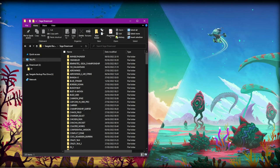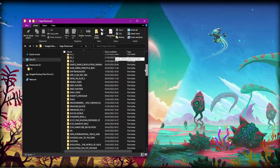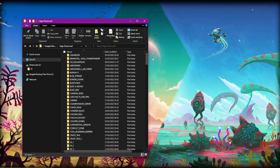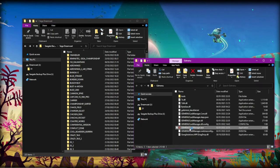This is the folder I've been using to store all my Dreamcast GDIs as I backed them up — it's become a mammoth task. There's over 250 gigs worth of disc images. We want to get as many as possible onto a 128-gig SD card and the rest onto whatever I can find. To prepare the SD card, if you're using anything over 32 gigabytes the card needs to be formatted in FAT32. Newer versions of Windows only let you format up to 32 gigabytes, so just search for SD card formatter software online and that'll sort it.